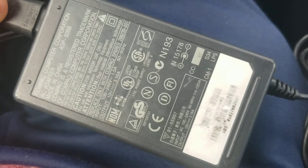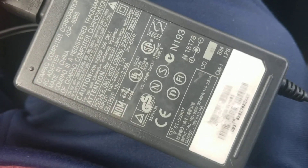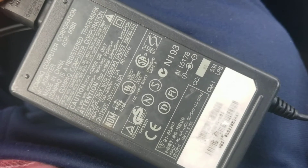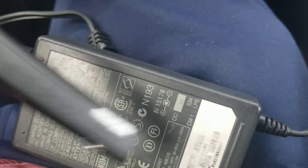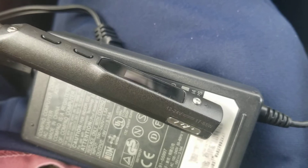I got this compact power supply as-is from Goodwill for $1.99, so that's a good way to go — scout Goodwill for a power supply, like a computer power supply that'll put out the right amps. If your TSP powers on and then shuts itself off and powers back on, it's probably because it's not getting enough amperage.